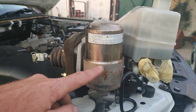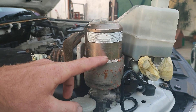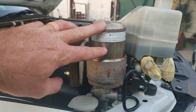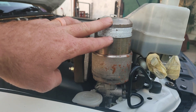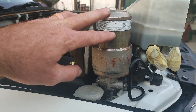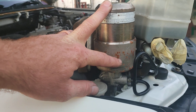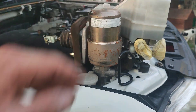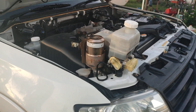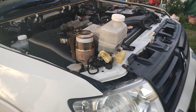There's a piston inside and on top there's nitrogen — an inert gas. The motor pumps brake fluid into the cavity, which pushes the piston up and increases the pressure of the nitrogen. So if you have a failure of the engine and press the brake pedal, you still have that stored pressure helping the brakes — anywhere between 10 to about 30 pumps to help stop the car. It's a hydraulic assist, so the electric motor does the work.